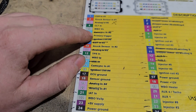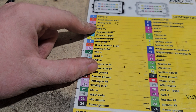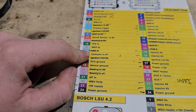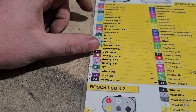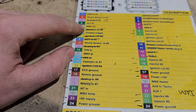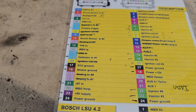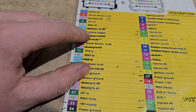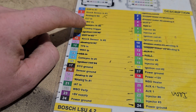Next we have cam sync — cam sync number one and cam sync number two. These are the secondary triggers — the cam sensors. Cam sync number one is the most important: it goes to your primary cam sensor on a 1JZ or 2JZ GTE non-VVTi. You can run both cam sensors or just one. Cam sync two can be used as a trigger to activate rolling anti-lag or a two-step — there's a pull-up in the ECU that makes it a five-volt switch. Number seven is the primary trigger — the most important one — this is for your crank sensor.